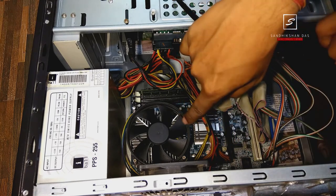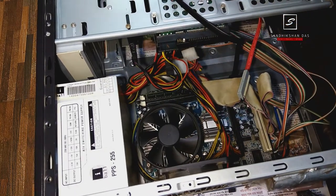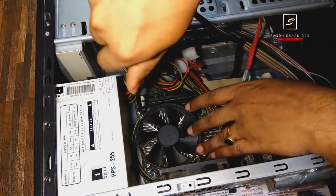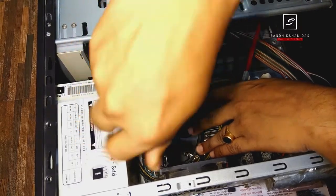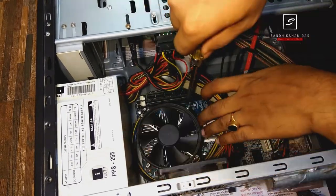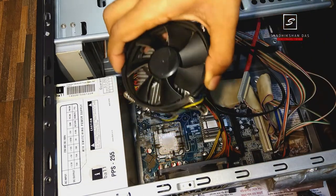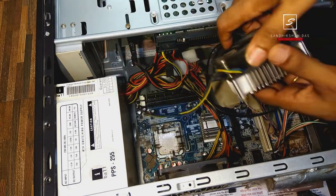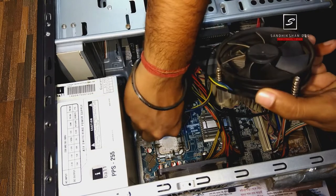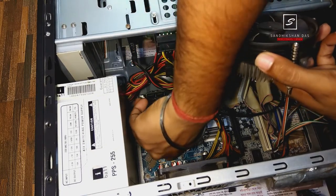This is the damaged one which I have to remove first, and you can see the 4 corner screws by which the fan has been attached on the motherboard. With the help of a screwdriver, just unscrew those 4 screws to unmount the cooler fan from the motherboard. When you are removing it, please pay attention and remove carefully — don't force it, as it can damage your pin.